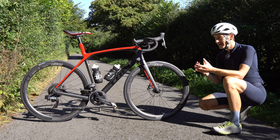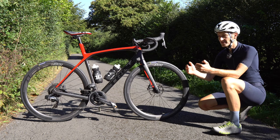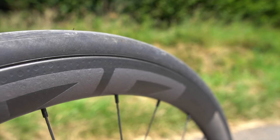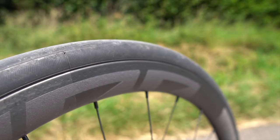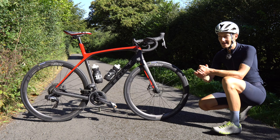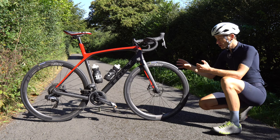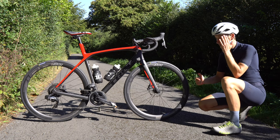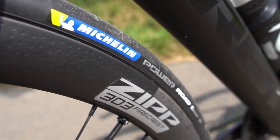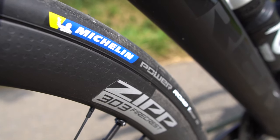But things are changing rapidly, and what's clear is rim manufacturers are moving ahead at a different pace to tyre manufacturers, and the standards being put down by the ETRTO, whose guidelines most tyre and wheel brands to a large extent do follow for tyre and wheel rim design, haven't yet kept up. So these standards are being developed and changed, and I was speaking to somebody off the record the other day, and they've just received a draft for changes that are likely to come out next year, which should incorporate hookless, tubeless and wider tyres. A lot of tyres are still designed to standards that, let's be fair, are out of date. So we need the standards to keep up. We need a few more things to fall into place before we have much wider acceptance and easier compatibility.